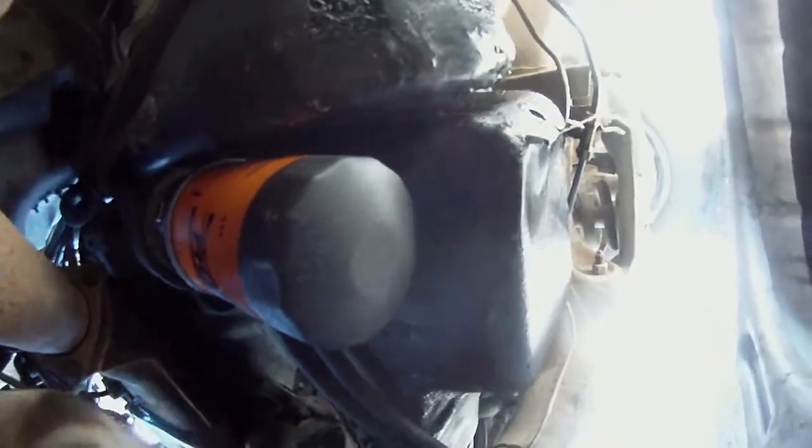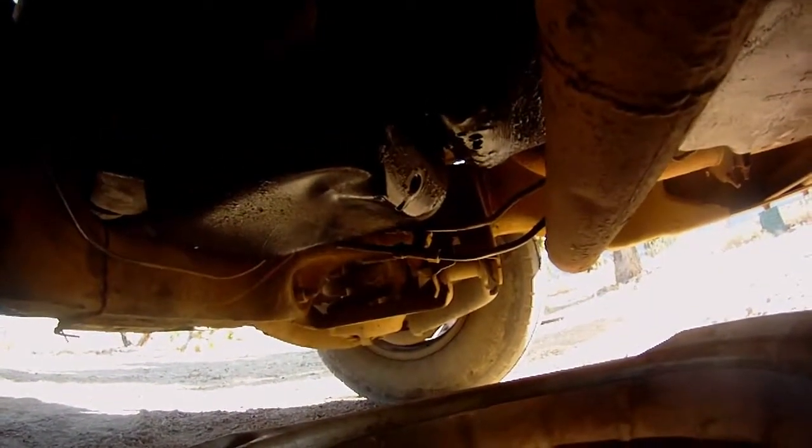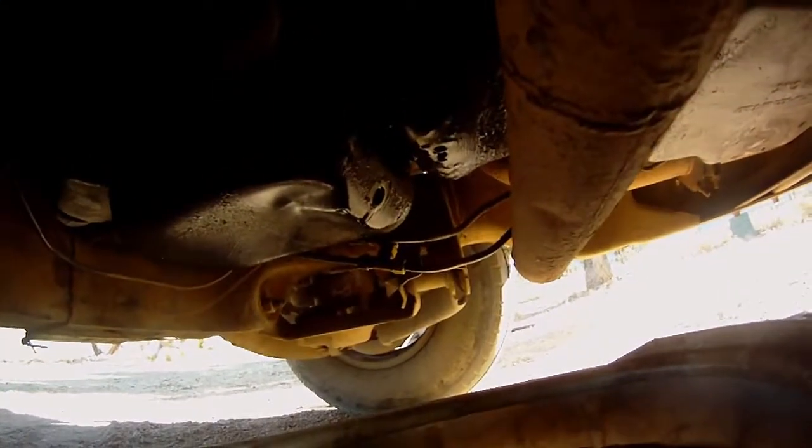Well, ironically enough, if you've seen my other video on replacing oil cooler lines, it looks like I'm going to have to take this filter and the oil filter adapter off again so I can get to some of these bolts that hold in the oil pan. I really don't think you could get around it, but since it's only the filter and two bolts, I would highly recommend getting it out of the way. Alrighty, looks like most of that oil is just about done draining.